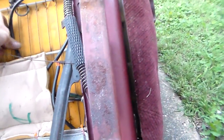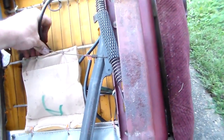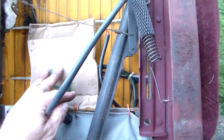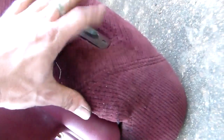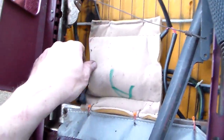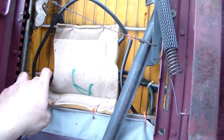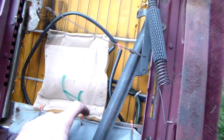I also have to issue a correction. In another video, I may have called this little thing here a sensor for the airbag — well, that's totally incorrect. What this is, is a little air pump for the lumbar support over here. I'm not going to hook this up because the original seat didn't have that, so I'm just going to tuck that harness out of the way. But if you have a 12-volt source in there, you can hook it up and it should work fine.